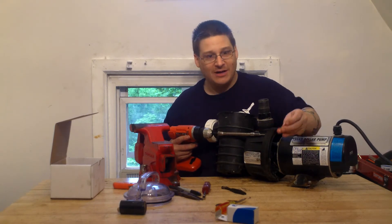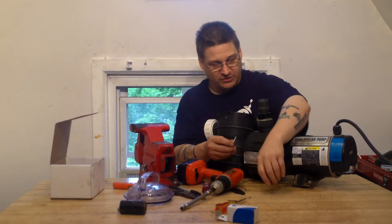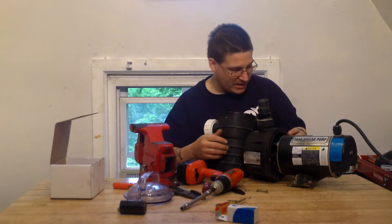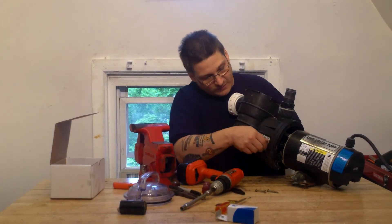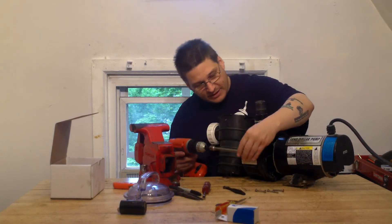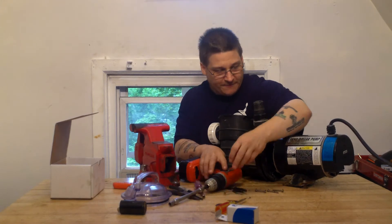What you want to do is remove the bolts all around here just like this. If yours are rusty, you might want to back it off a little more slowly. Around this whole pump there are about six to eight bolts. You want to remove them just like that. There are a couple underneath right back here, one over here, and one back on the side here.